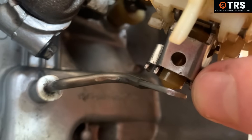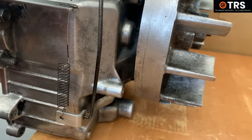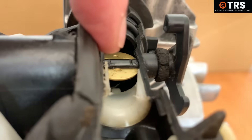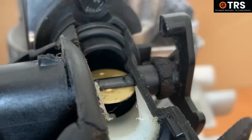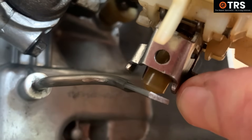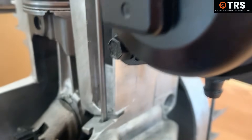As we know, that will push this centrepiece out. When this is in position and that plastic centrepiece is pushed out, it pushes down on the lever. This whole rod is forced down against the spring, and that closes the throttle plate. This is basically how it governs the system. The engine starts on full throttle with maximum airflow, and rather than the engine revving high enough to damage itself, this mechanical governor system kicks in and adjusts the leverage, closing the throttle plate accordingly, thus lowering the revs and saving the engine.